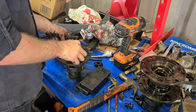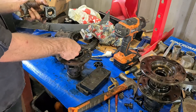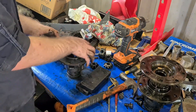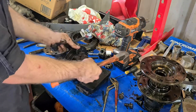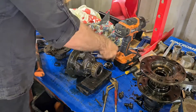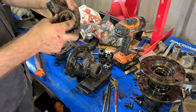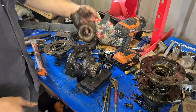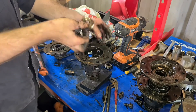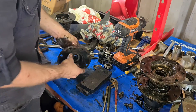You've got one gear out and then that pin in the center should slide out nice and easy. All this stuff in here should be clearanced in a way that lets it spin. Now we've still got the pin in this one — it's going to be easier to punch it back through this way because we can get the leverage on it. Whatever you're bracing against, try not to mash your bearing. Your center gear just kind of floats in there — just pop that out, you don't need that anymore. You'll have little bearing shims, smooth surfaces for the spider gears to spin against.